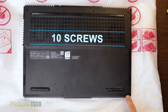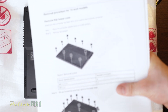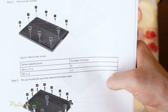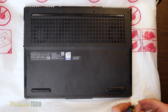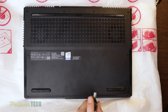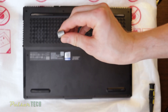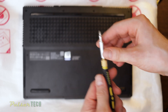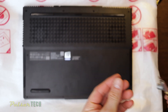As you can see on the back, there are 10 screws holding the back cover to the laptop, so we want to unscrew them all. I highly recommend downloading the service manual and printing the page showing where those screws and clips are, because this will help you safely disassemble the laptop without breaking any clips or the cover. A quick tip: if you find the screws are recessed pretty deep and you cannot get them out, you can use a small magnet attached to the screwdriver — or a magnetic screwdriver — to lift them out of the recessed hole pretty easily.